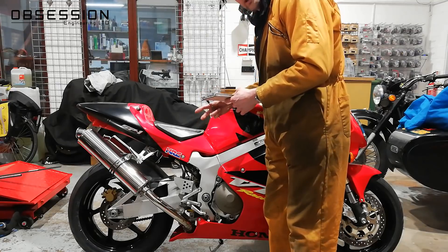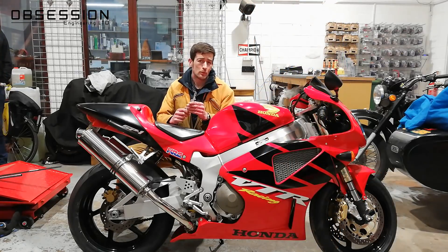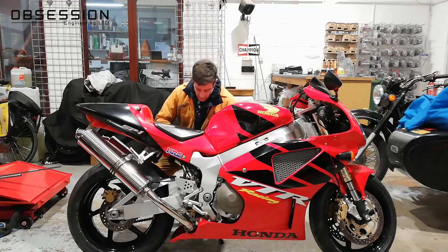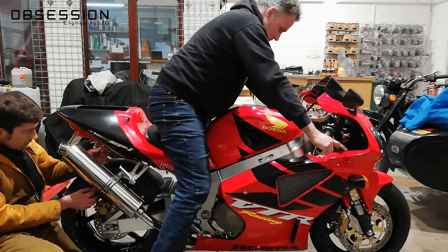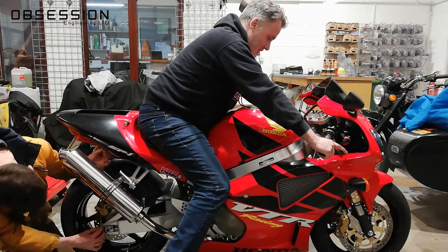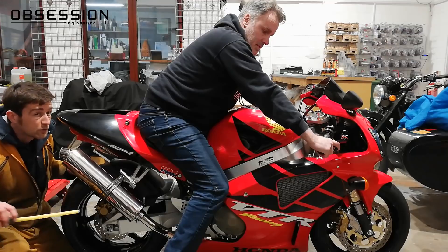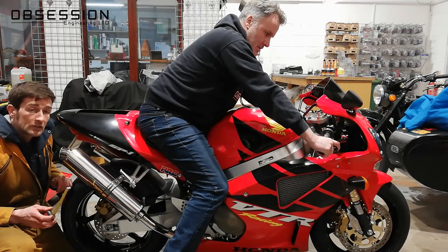Because the shock is quite awkward to get to on this bike, Henry still has the correct C-spanner in his toolkit. I take some adjustment off and then measure again. That's 431mm, so we've made a definite improvement — now at 34mm of sag. We'll go a couple more clicks to get exactly where we want to be.